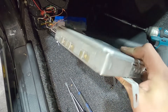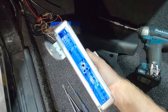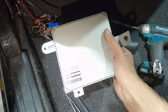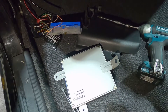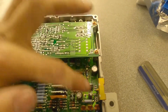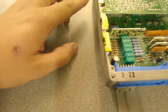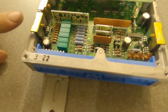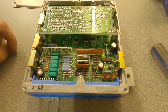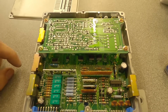The ECU is out. It's a pretty standard sort of 90s Japanese car ECU - square grey box. We're going to open it up and you can see how this blue connector here matches up to the circuit board that Link provided us, so we just open it up and swap them over. Here's the ECU with the top cover removed. There's a whole bunch of screws on the circuit board we need to remove, as well as these extra screws, a daughter board, and bits on the side with heat sinks. Be very careful with these old Japanese screws - they have a tendency for rounding.